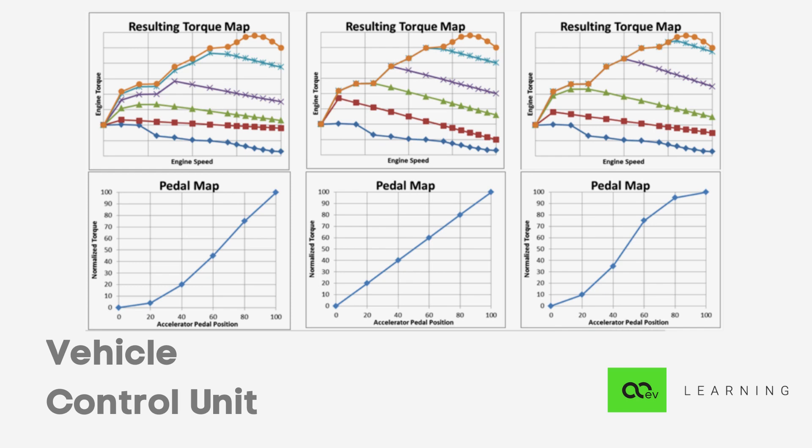The curve is flattened at the lower end for less jerk during takeoff and at the top end to regulate energy consumption. The energy consumption at the top half is insanely high — because you are already at a higher speed and if you want even more torque to accelerate, a lot more current is required owing to falling efficiency. We can dampen the effect of the pedal-to-the-metal condition with a thoughtful strategy and ensure a longer range.